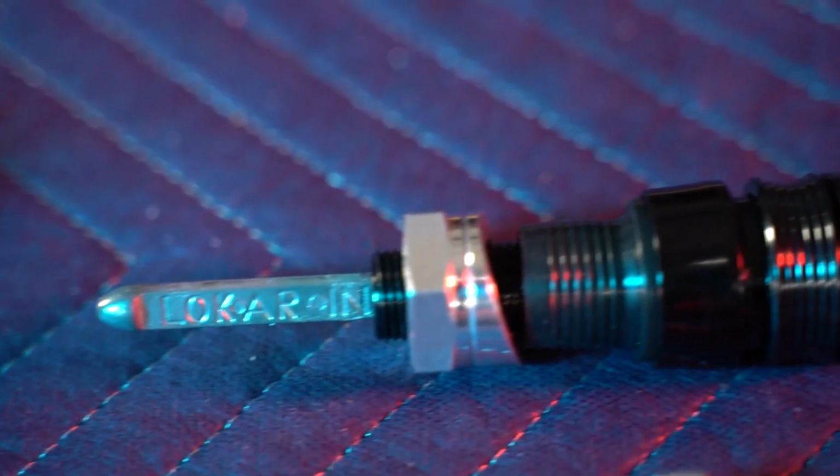Yeah, and we've got a true locking dipstick that actually attaches to the pan, not just locking at the handle. That wouldn't have happened with our dipsticks. Yeah, not at all, because you got a dual redundancy. Yes. Not only is the base locked into the transmission's casing, but the dipstick is locked into its base. So it's not going anywhere, and the same thing with the oil dipstick. And in that way, the catch can work properly and do its job, which is to evacuate the pressure, catch the oil, and not let anything shoot out of anywhere.